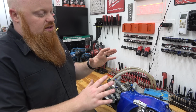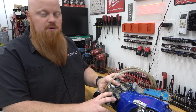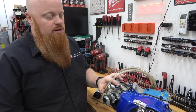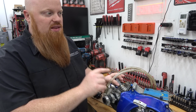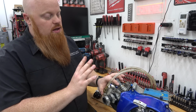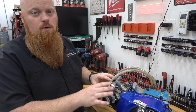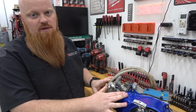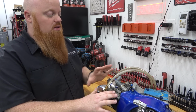So again, this is the Tillotson 225 builder's kit that Go Power Sports has. It basically comes in a box. You put it all together. I did, I think, the Hot 265 cam in this. It has stock valve train, stock head. This head does flow a little bit better than a stock head. And it has a billet rod and a billet flywheel and a flat top piston. So that's all that's been done to this.